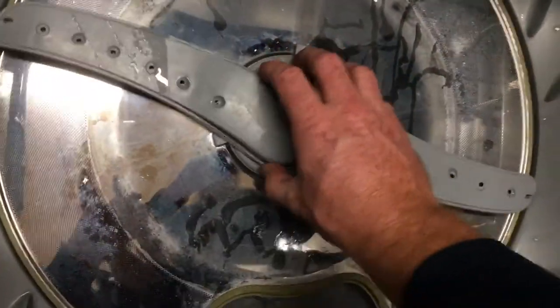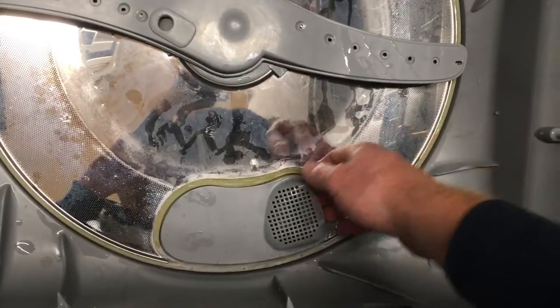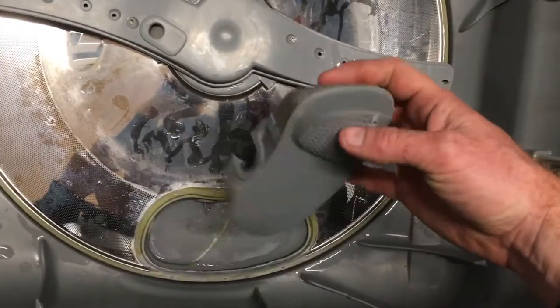The spray arm sits on — as I said, it needs to be on properly so it can measure the water level. Then the filter goes back. It pays to check these filters every now and then depending on how often the dishwasher is being run, just to make sure everything is cleaned out after a cycle.